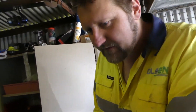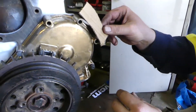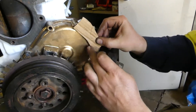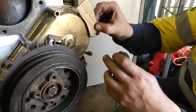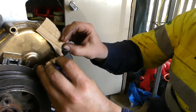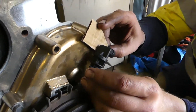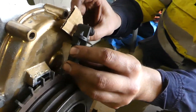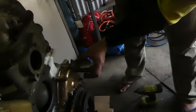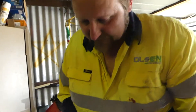The plan is: we've got this little bit of cardboard as a rough guide, and we're going to cut out a bit of steel, drill some holes in it, weld a little tab, and mount the sensor. Maybe position it like that - a little tab there, two bolt holes, and then mount the sensor there and there.